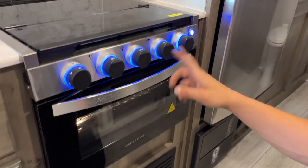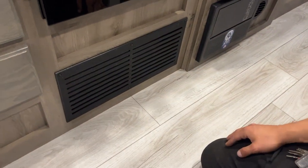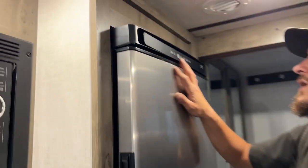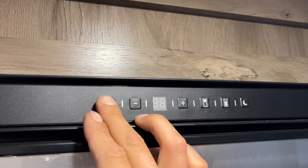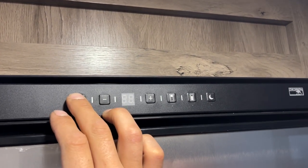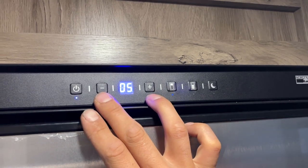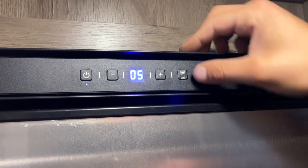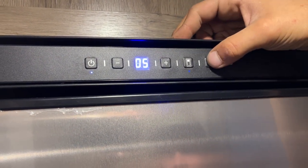The button on the right turns on all your knob lights as well as your oven light. The return air grill down below is just for your furnace — make sure it's not blocked off. Your fridge controls are all across the top. This is a 12-volt fridge — the power button turns it on. Plus and minus there for selecting your temperature: five is coldest, one is cold. The freezer section controls that temperature separately; the other controls the fridge side.